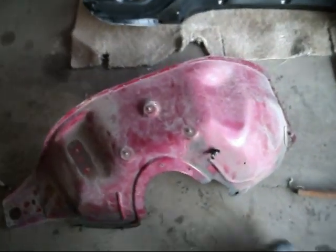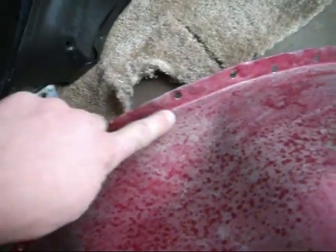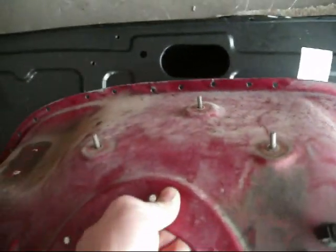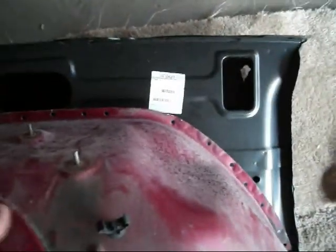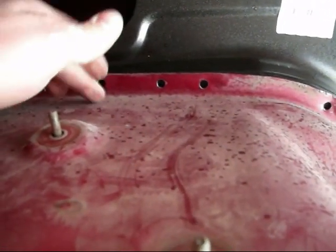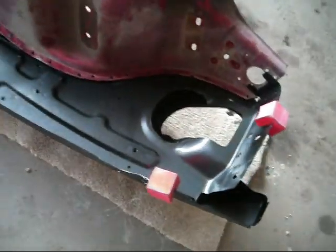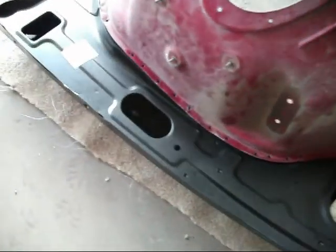It's all spot welded, and the new fender just doesn't come with this inner piece, so you've got to use your old one. I took a 5/16ths drill bit and drilled a hole where every spot weld was. Then you just pull it off and put it on the new fender. You can weld those holes shut if you've got a MIG welder, or I'm just going to use some self-drilling tek screws. I sprayed rust inhibitor on both sides to keep it from rusting, then I'll put a screw in every one of those drilled holes.